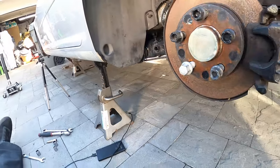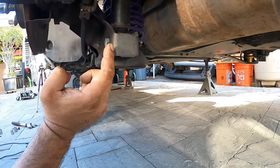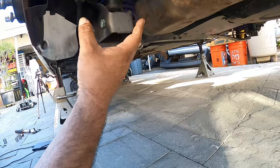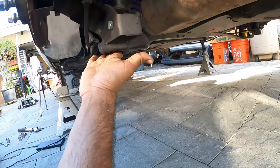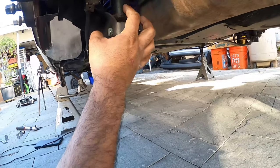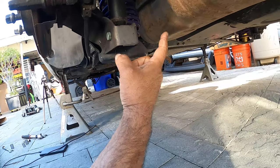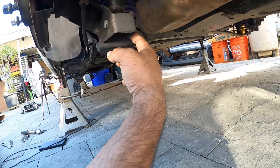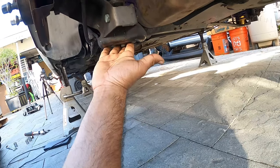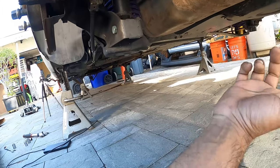Right here, we're going to get our 16 millimeter socket and wrench and unbolt these — do not remove them yet, just unbolt them. Then we're going to get a jack underneath here so we can pretty much drop the amount of pressure on the shock. That allows us to pull the bolt out and swap the bolt. You're going to swap one at a time — the reason is you don't want the whole beam to drop on you. Just have a jack underneath, break these loose, pop one out, pop one in, and repeat the process on the other side.